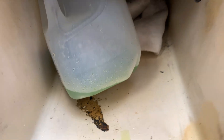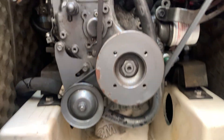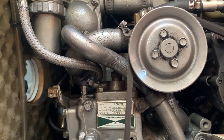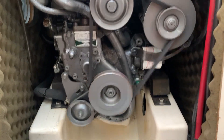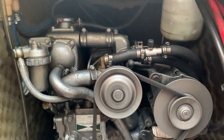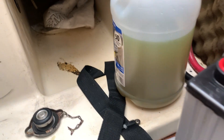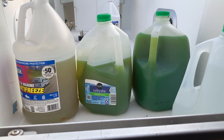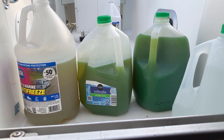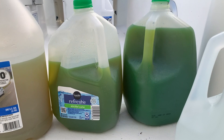Getting some light green fluid. Here's what it's looking like after one flush. I drained the heat exchanger on the top valve and then the block on the bottom. We'll fill it up again and give it another go. This is round two — you can see the different jugs. That was the first one, just making sure I'm getting all of it in and all of it out each time, repeating the process. The first two are very close in color.